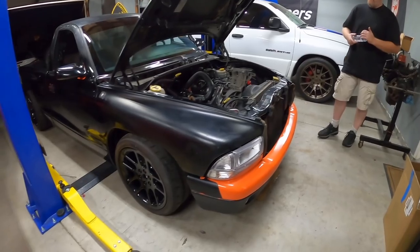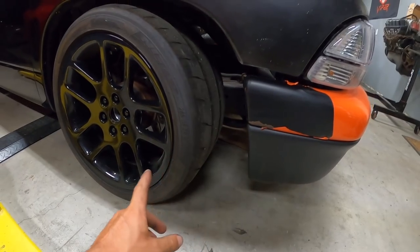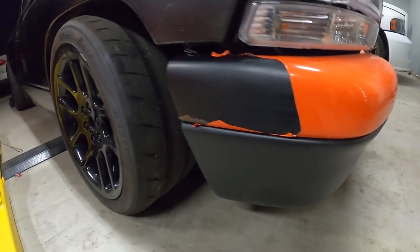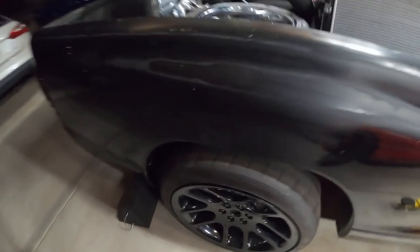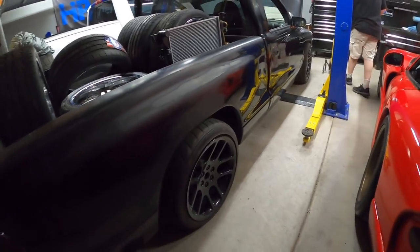Suspension is not real friendly, he's not kidding when he says that. He's got the SRT10 Viper wheels on here with spacers - looks like 2 inch or inch and a half. He's got DJM 3 inch drop arms with cut stock coils. See how low that is? It literally goes almost lower than the actual truck frame. This thing is insanely low. He doesn't have a C notch in the back and it is just on the frame right now - this is literally just framed out. So we're gonna do some stuff with suspension.